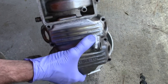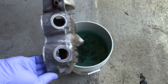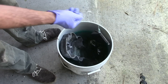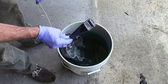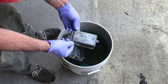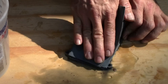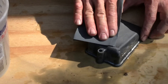The valve cover is stripped one more time. I think there was a little clear coat on there — I saw a little bit of some stuff come off. So back into the bath with it. We'll pull out the other part and see what it's looking like. Yeah, it's nice and dark, which means it's been etched pretty well. I'm just going to call it good enough on that one — it wasn't that bad. So I'm going to rinse this really well now with fresh water. What I'm after here is to take off that dark layer, just get it down to something aluminum and shiny that I can polish.